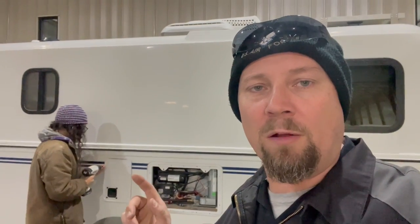We're back here on this Escape. Mr. Adrian's been working on this little Dometic furnace. We were getting a one-flash code — it would come on and then within 15 seconds the fan would turn it off. Typically that's a sail switch problem. We did find out that it did have trash in the sail switch. He's gone in and cleaned it, and he's going to put the cover back on and rerun it, because I've seen over the years they run good with the covers off but put the cover on and it quits running. He's going to double-check that.